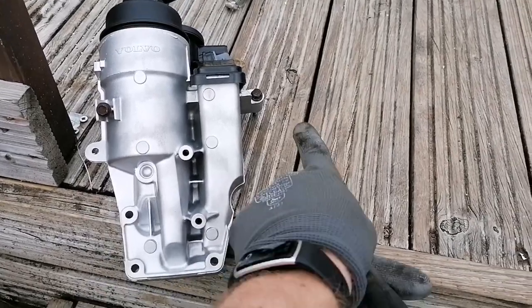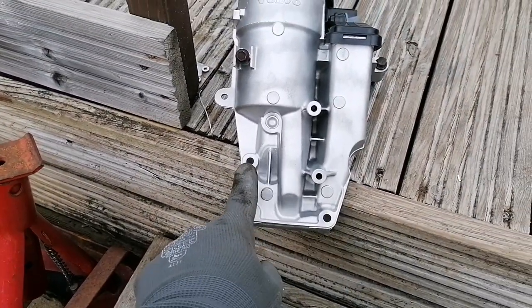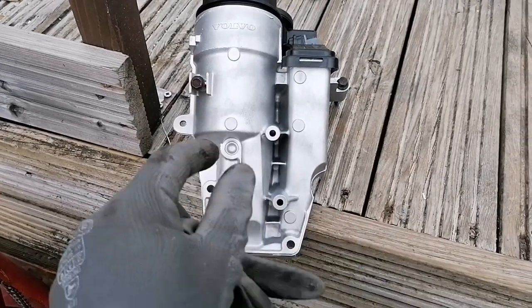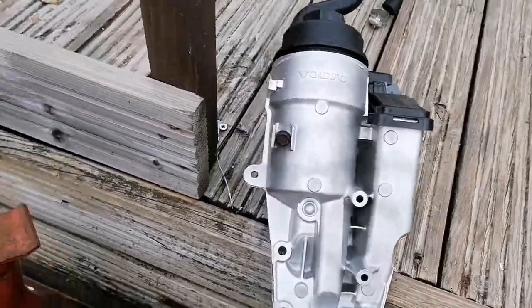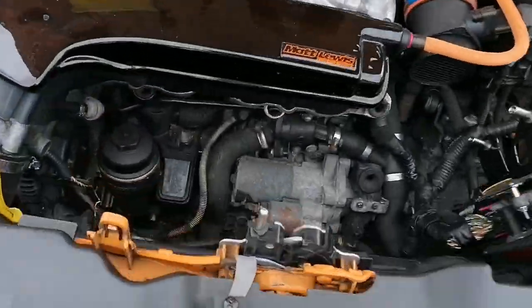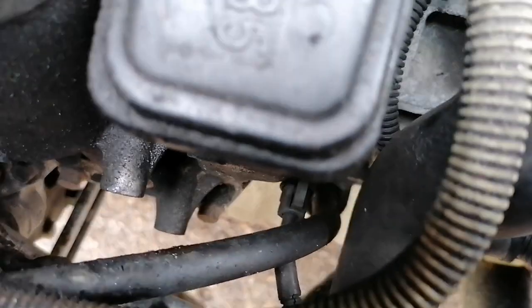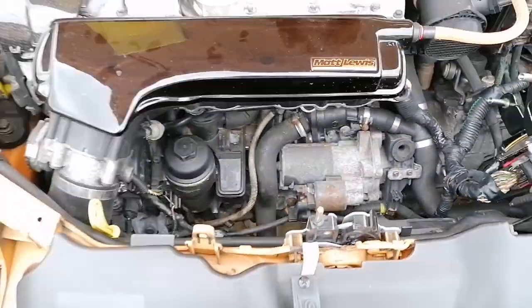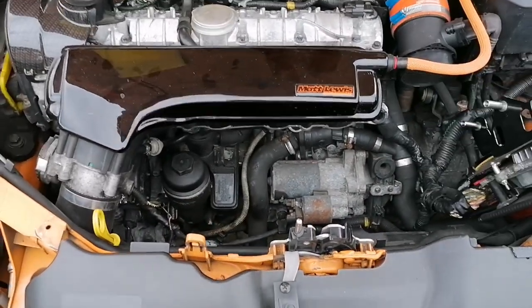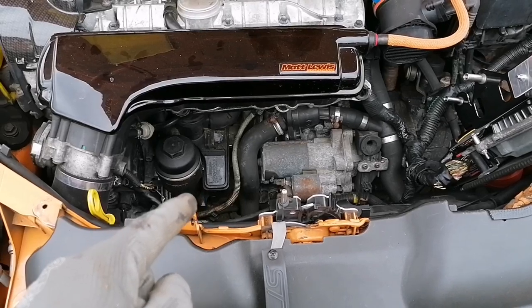To take the unit off it's bolts one, two, three, and four — one goes straight through and bolts into the block, and I imagine the same for the other three. So it's only that one hole you'll have to re-thread, but I lined it up, turned it with my fingers, got a ratchet on it and it went in fine. I'm going to get those three underneath undone, and I'm hoping I can keep the oil that's in there because I haven't actually drained it — I haven't been able to get the service kit yet as I missed the next-day delivery deadline.